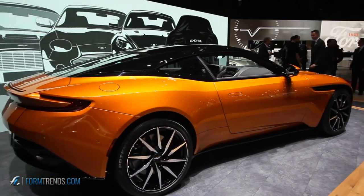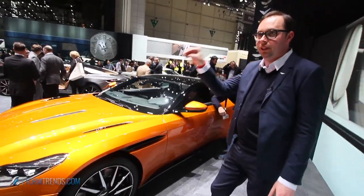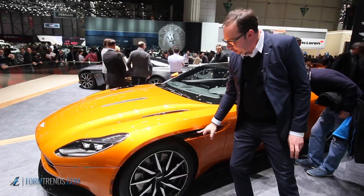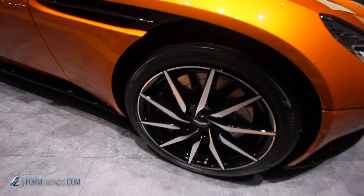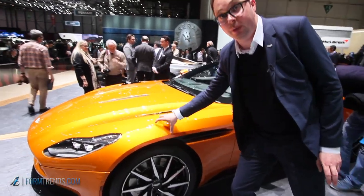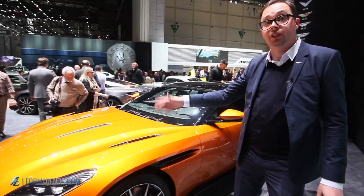On the side of the car, it has very, very integrated aerodynamics. It's not a case of sticky plasters like we'd see five or ten years ago — it's a full system. Starting with the side strake, which is very much reimagined for this car and was inspired by what we did for CC100. The side strake is actually meeting the wheel arch, and the reason it's doing that is we're actually venting air off the top of the arch, releasing pressure there, which increases downforce at the front and reduces drag.